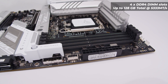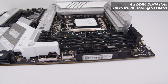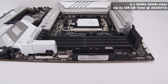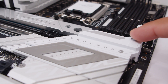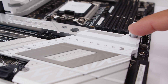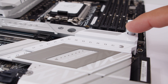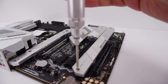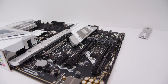As mentioned, this board only supports DDR4 memory and supports up to 128GB of DDR4 RAM at 5333 mega transfers overclocked with XMP. There's also a button here which opens up the top PCIe slot. You'll notice that when pressing it, it's actually pushing the spring mechanism back - this is new for these Z790 boards. Although the Z690 boards had something similar, this mechanism is slightly different. Let's pull off the M.2 cover to take a look at the M.2 configuration on this board.